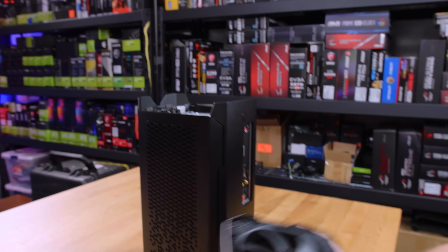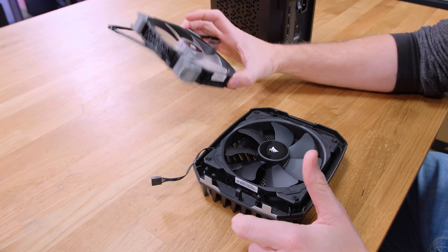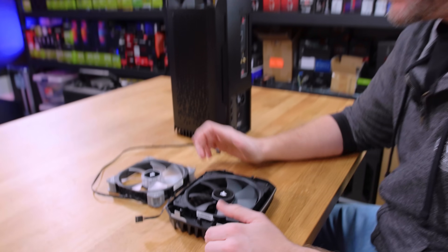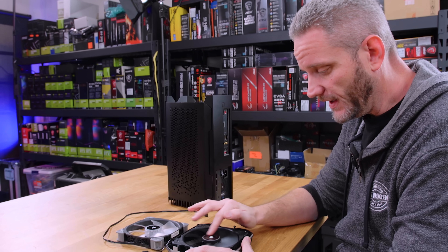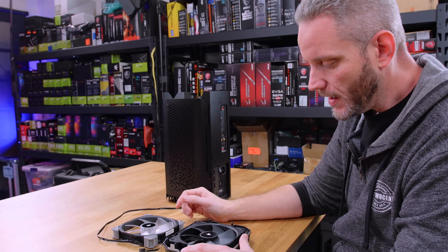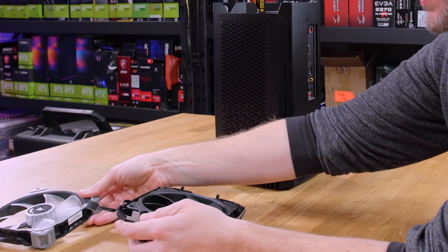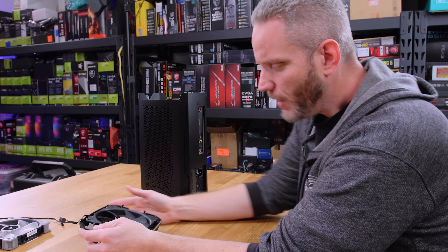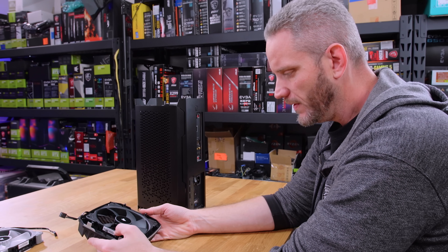The fan that's in here — we're pretty sure it's actually a Maglev fan. This one is a 2000 RPM fan, so obviously we're going for performance rather than acoustics. The original was very silent at 1500 RPM, so going a little higher should give us better performance. Both are PWM. You can use any fan you want in here — I'm probably going to try a few different fans as I play around with this system.